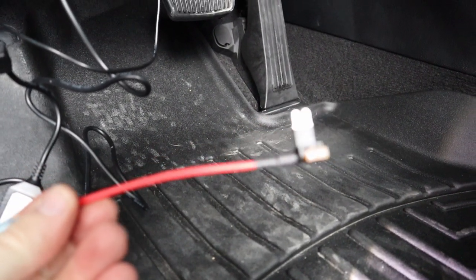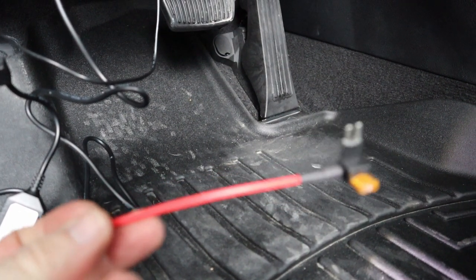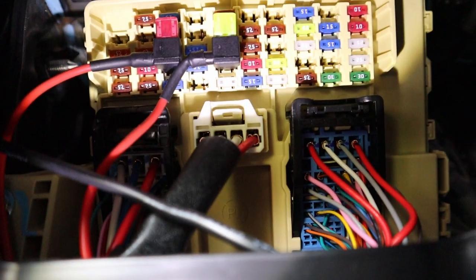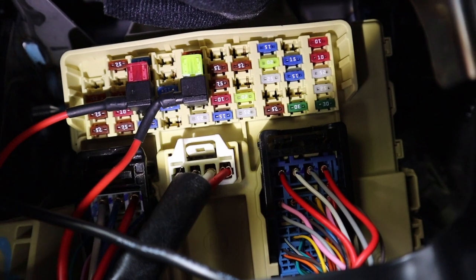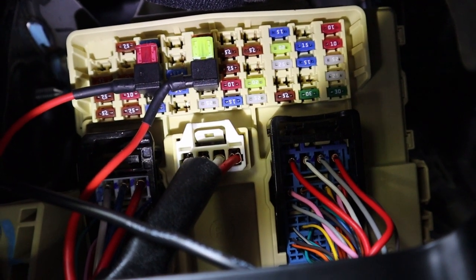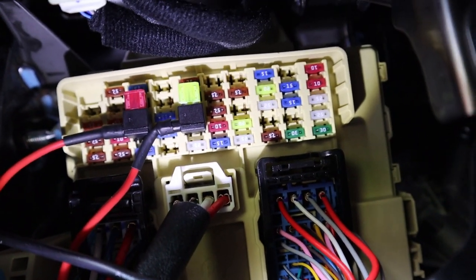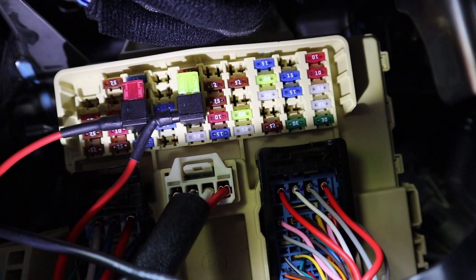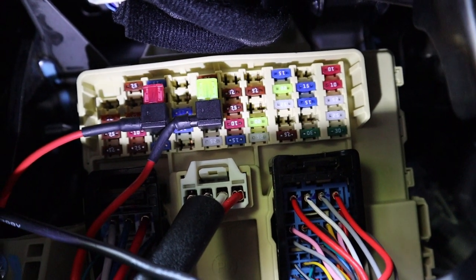All right, so we're using our micro tap-in fuse kit. I'll post the link to that kit in the description box. And your power wire is going to go into a power constant fuse. And then the accessory wire is going to go into a fuse that only gets power when the accessory is on or the car is running. You need to make sure that you do have the initial fuse that you're pulling out, as well as a secondary fuse in the tap kit to close the circuit.